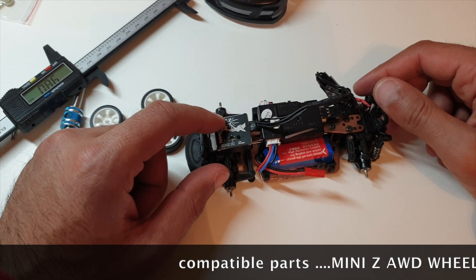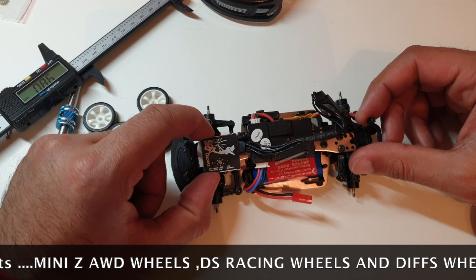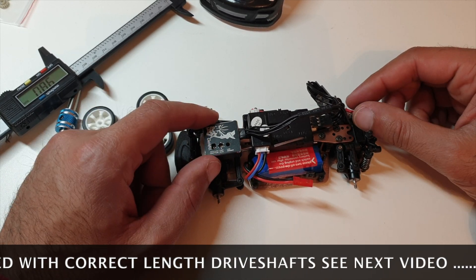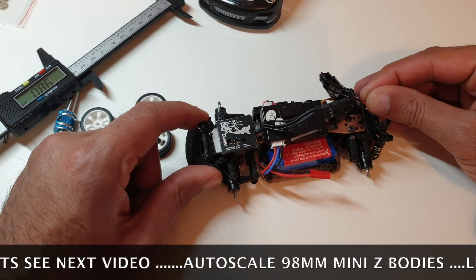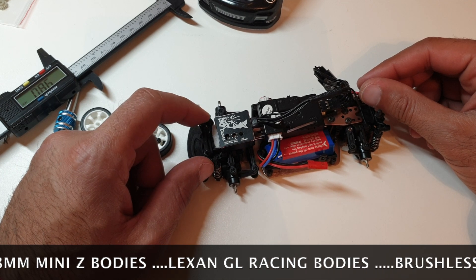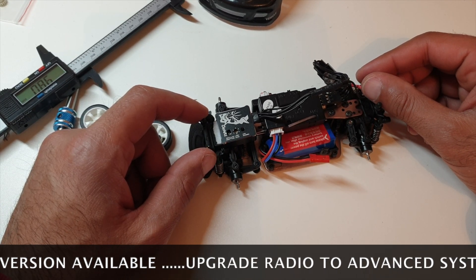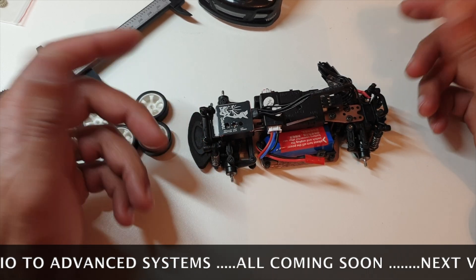I've stuck this gyro on - you can get the new second generation gyro from Banggood, which I'll leave a link for down below, for about £25. So that's pretty much a ready-to-go drift car. All I've done is add a gyro and instantly I could do mini drifts, long drifts, wide drifts straight away without too much messing about. Gyro was set to 50% - off you go. That's the quickest and easiest way of getting drifting without learning the skills from scratch.